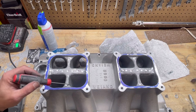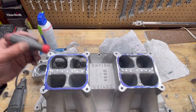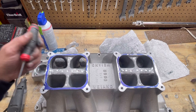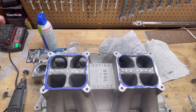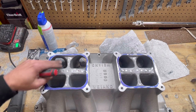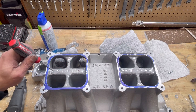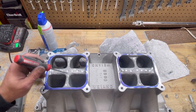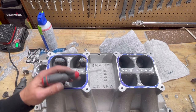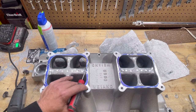It's not the prettiest thing in the world, but you know what we did do is we gasket matched, port matched, whatever you want to call it, the spacers to the upper intake plenum. We got all that radiused out for better flow, more even flow, and kind of match it where the carburetor sits. And then we did the same thing on the bottom here and just cleaned up the casting flaws, rolled that out, opened it up, and put what I'm going to refer to as David Vizard's little secret. I really do think this is going to work. I did a lot of research on it, and it does make a lot of sense. And seeing the guy has been doing this for a very, very long time, longer than I've been alive, I'm going to take his word for it.